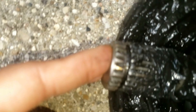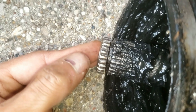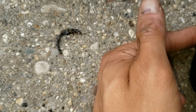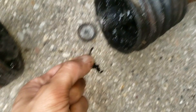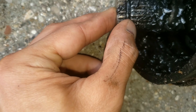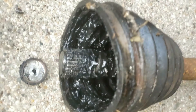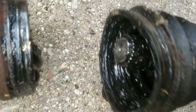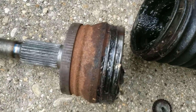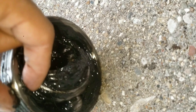So you can better understand the problem, look at the end of the inner side of the CV axle. There is a ring on here that keeps the inner side CV axle connected to the differential, so don't ever take those rings off when replacing or reinstalling onto your vehicle. On the left side or outer CV axle area, that clip is located inside of the rubber boot. By the way, that clip is also called the retainer ring, snap ring, C clip, circlip, or compression ring.